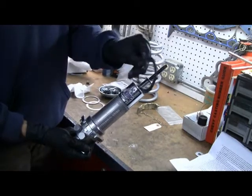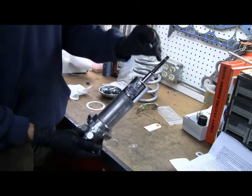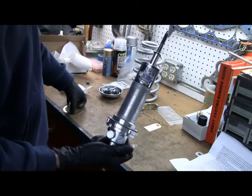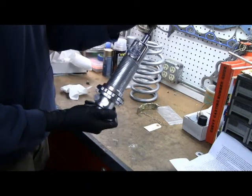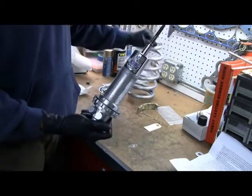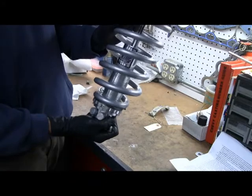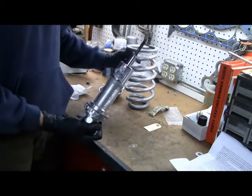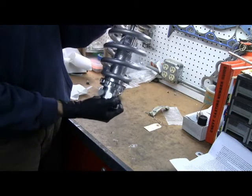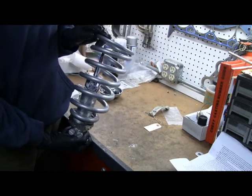One of the main reasons I bought these is to adjust my ride height - once and done. Then you put a regular washer on, then your thrust washer, then another regular washer on top - so the thrust washer is sandwiched in between. The spring sits on here like this, and as you adjust these collars up, it adjusts where the spring rides - that's how you get different ride heights. This part goes up into the frame just like a normal coil spring.